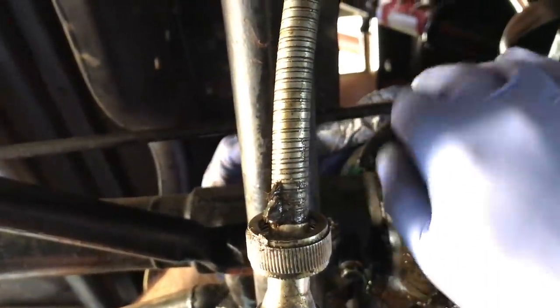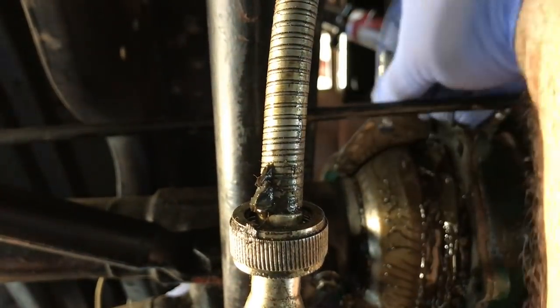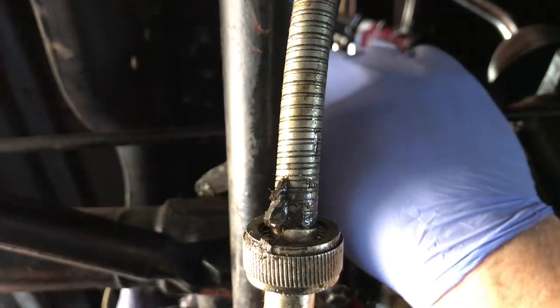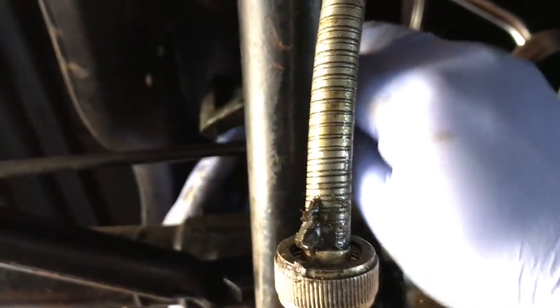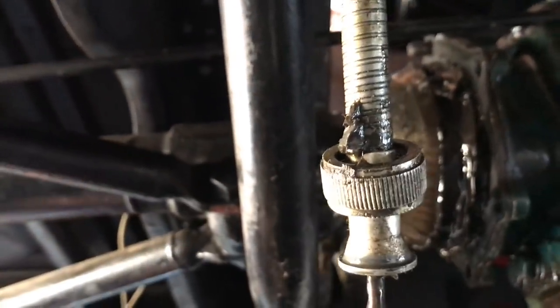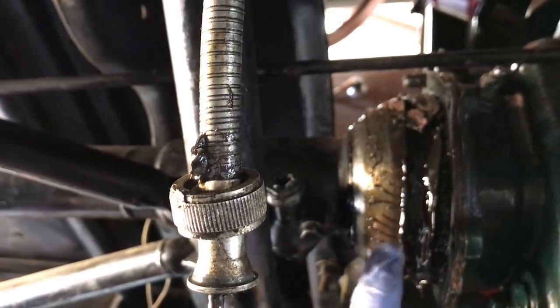This thing's full of grease and goop — this pan is down here not just because of the motor leaking, it's here for a reason. You want your U-joint to look like this inside — that's what you want. See how greasy that is? That's good. I asked how many times you grease it, and the answer was: until you think it's got enough, and then a little bit more. That's the right way to do it, and that's what it's supposed to look like.